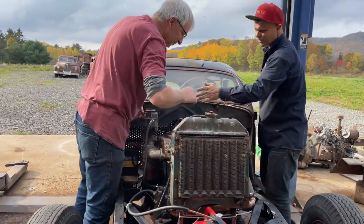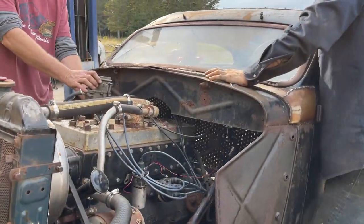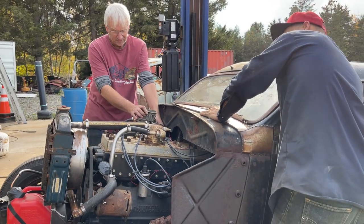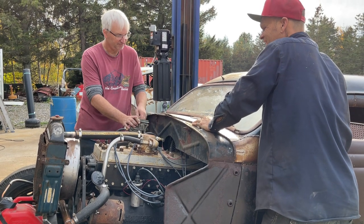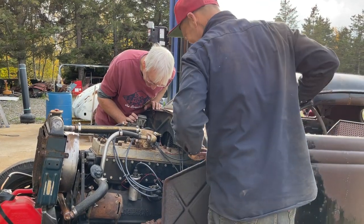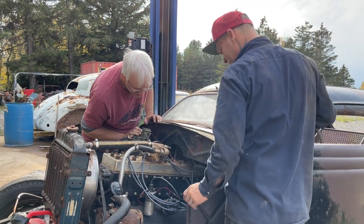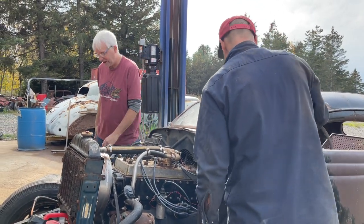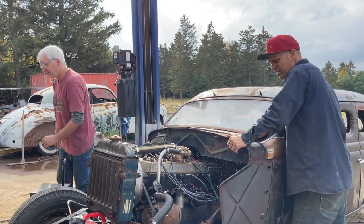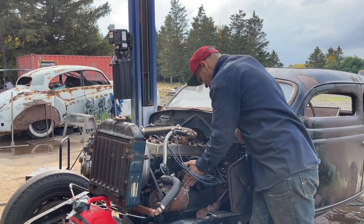Well, it should have kicked there. Did it? Okay. Up is on. Up on, yep. Not even kicking. No. What the... It doesn't make sense. I know. It's a car. Is it our fire and our points? Did you clean our points? Yep. They're good. We had decent spark there. I don't know. Maybe we're not getting our spark. That's it. Might not be coming up through the cap. Yeah. We might not be getting the spark that we need.